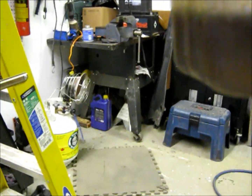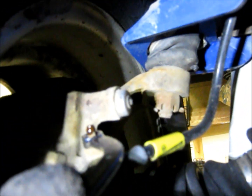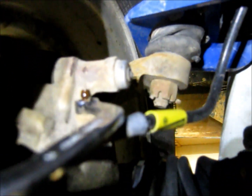I get a tight fitting tube on here and put it down in a reservoir that's got some fluid in it. I want the end of the tube in the fluid so that the tube can't suck up any air. Once you've got your tube on there, I'm going to crack the bleeder nipple. Just as I'm cracking it, I say 'push.' Matthew pushes the brake pedal to the floor and says 'holding.' Then I close the bleeder nipple — you'll see fluid going through your clear tube, and once it slows down you'll see air bubbles, maybe black fluid or some water. Once the flow stops, close the nipple. Don't open the nipple more than a half a turn or the threads start to open and you lose your seal. After you close it, you say 'release,' and Matthew says 'released.'